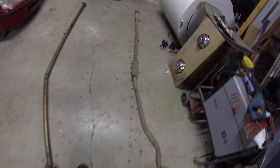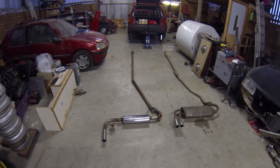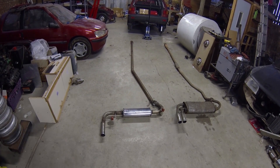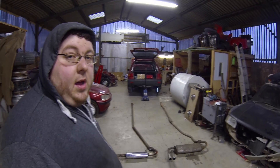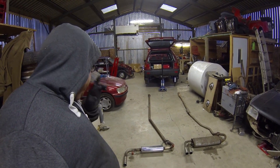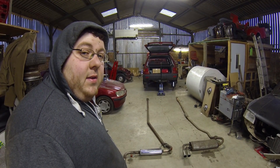There's a blow here, there's a blow there — you can see the crack there, look. There's a blow in the gasket there too. This one is one I built myself, about two or three years ago now. It's not perfect — all done by eye. It's a true two inch, all mandrel bends, there's no crush bends in there. And yeah, it's nice and loud when you want it to be, but when you're cruising it's quite a nice hum — not really a droning noise, quite lovely. So all along it's nice and quiet. I don't know how long I'm going to keep it on this — might keep it on for good, might keep it on for a short period of time. Let's get it fitted and crack on.